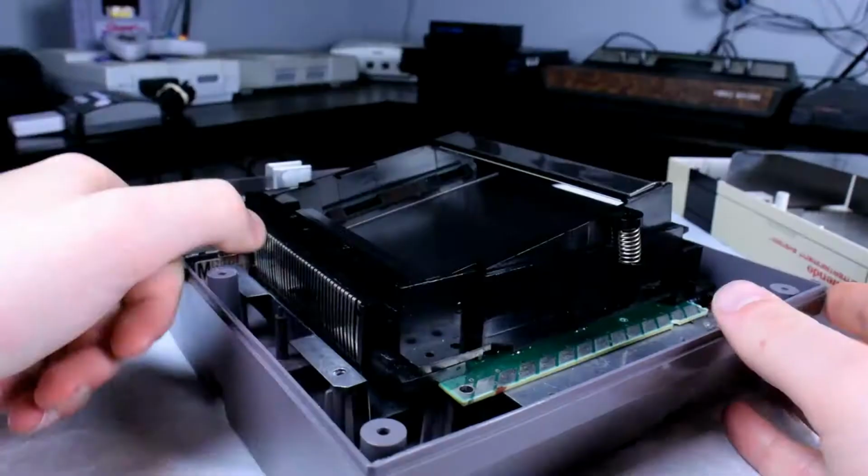However, over time, the mechanism saw the rise of many issues. For one, pushing down the NES games in the actual slot would mean that the pins would bend over time and be prone to dust. Nintendo's choice of materials also didn't help matters, as they didn't have the clairvoyance of the longevity of the console. The springs were made of nickel, and they would lose their spring over time, making sure that the game wouldn't hold in place anymore. The other materials issue were the pins.